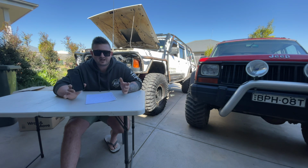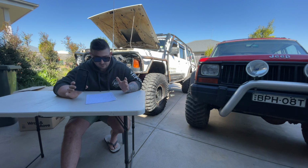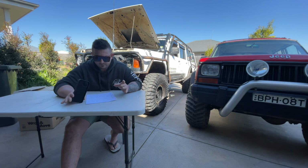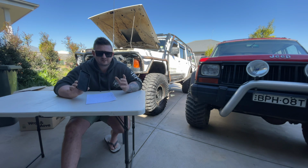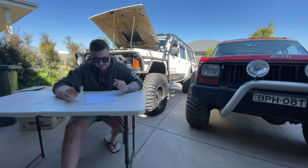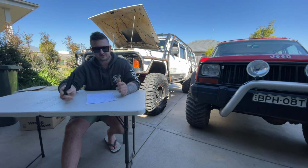I'd probably build the motor. There's no difference between silver tops and black tops. You can tell me there is, but there's not. And I would run obviously a 12mm pump and a good size 18 or 20G turbo. I'd probably stick with an 18. And that would be my combo. Again, 4-inch bonnet entry or 5-inch bonnet entry snorkel, and a 3 to 3.5 inch exhaust straight through. That'd be my combo. Everyone's different, but that's what I'd do.